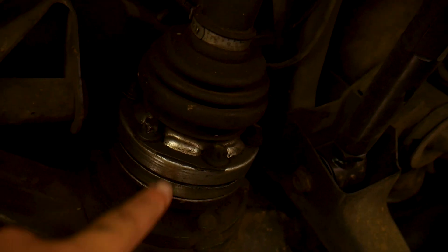First I gotta take off the drivetrain. You can kind of see these nuts hit the bottom of my car quite a bit - that's where the scratches are. I'm gonna need to paint that once I get this off so I don't get rust. Then take off the CV axles and these two bolts in the back. I don't think I have the right tool so I'm gonna have to go get those.